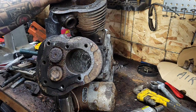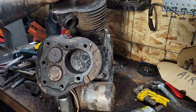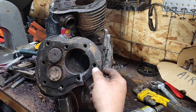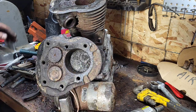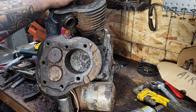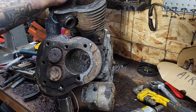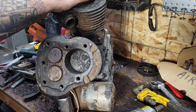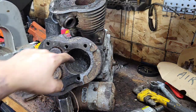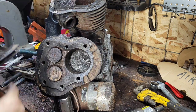These cylinders normally you just give them a light tap to break the seal and slide them off. When they're this rotten it's a tough deal. This cylinder is actually loose now - I should be able to pull this off by hand. Now I know this thing is way beyond where we want it repair-wise. What I'll probably do is start drilling out this piston along the cylinder wall to relieve the tension. The cylinder wall is like 40-grit sandpaper - the cylinder wall is grabbing the piston to the point that we broke this ear off.